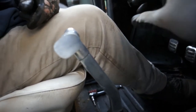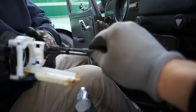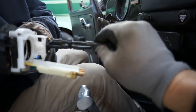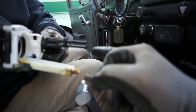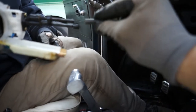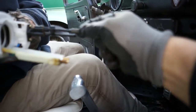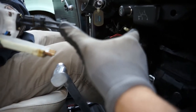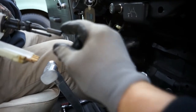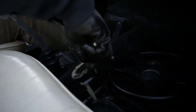Here's your washer hose assembly — this one has part of the hose still on it. You can see the two little nipples where your vacuum line and washer line are going to go. They're about the size of a vacuum line. If you need to, cut it here and just replace it with a six or eight inch piece using a vacuum line splicer. Now he's got that out, we're going to set it down on the ground.